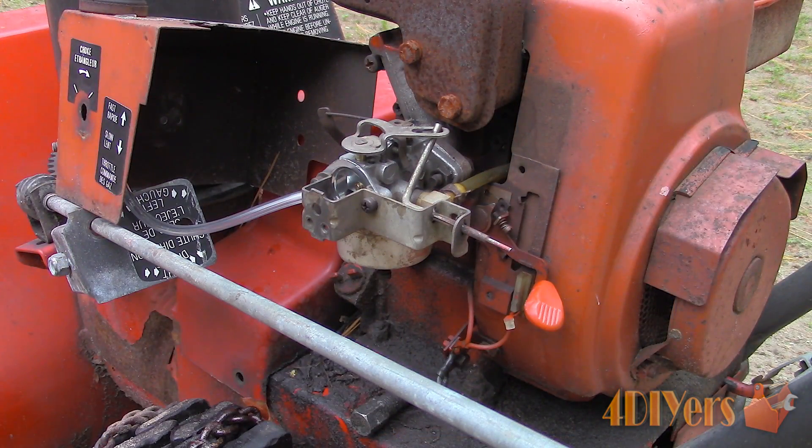Reinstall the carburetor back onto the engine block. Again, you can use the same blue medium-strength thread locker made by Permatex on the bolts. This concludes my tutorial video. If you have any comments or questions please don't hesitate to post them below. Please subscribe to my channel and like my video. Thank you for watching.